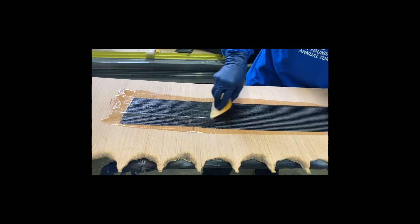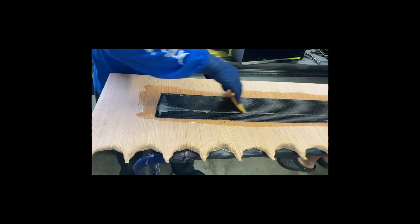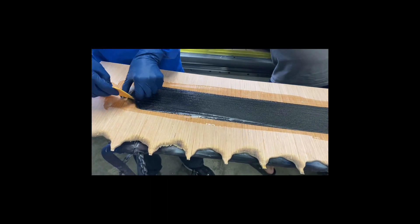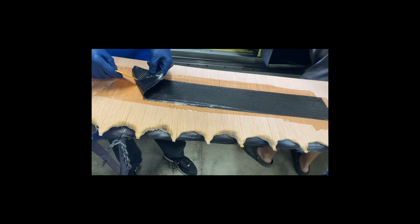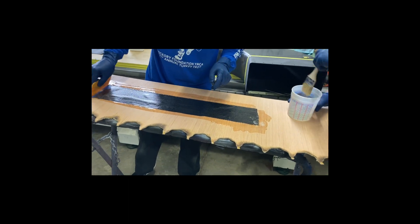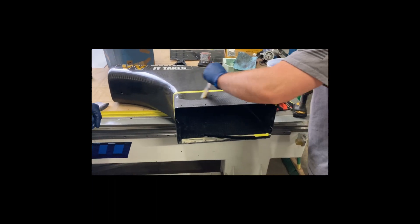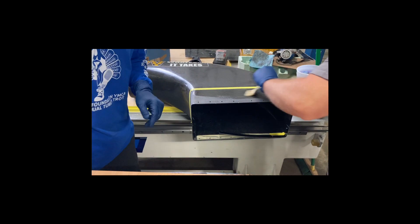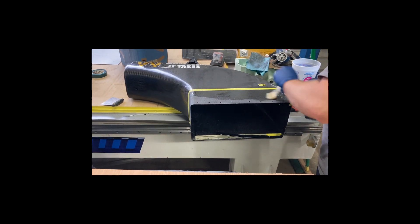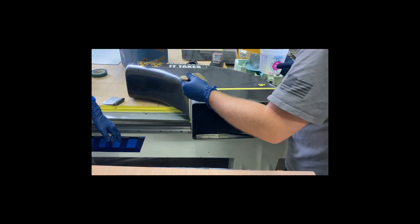I'll actually flip it over and permeate it through the other side so it's just completely full of resin. This resin is a two-part resin, much like fiberglass — you've got your resin and your hardener. Be sure and check with whatever the manufacturer is, because I've had resins that mix 100 parts of resin to just one part of hardener, and this one actually mixes two to one. So you have to make sure you're mixing to the manufacturer's specifications. Here Jeff's helping me — he's brushing on the resin onto the carbon that I've already ground down. I used some 60-grit and roughed it up. The tape line is just to keep us from spreading resin all over the rest of the scoop.